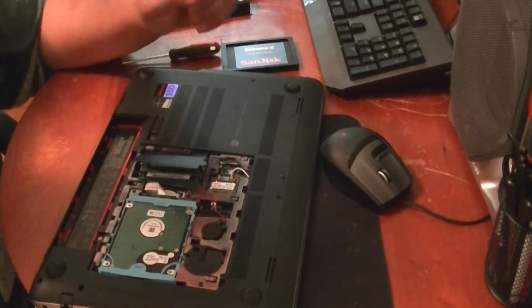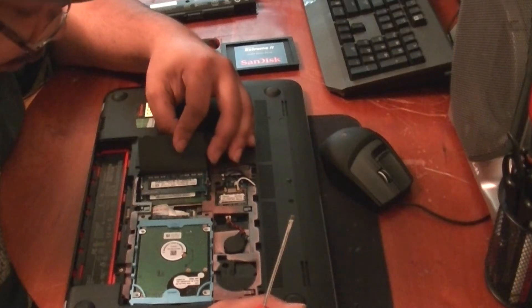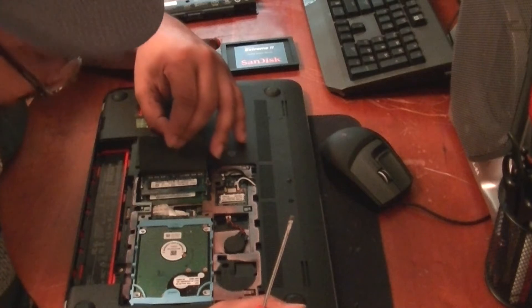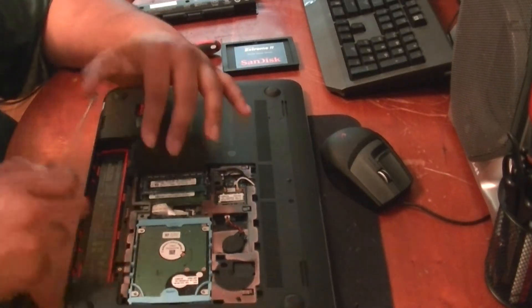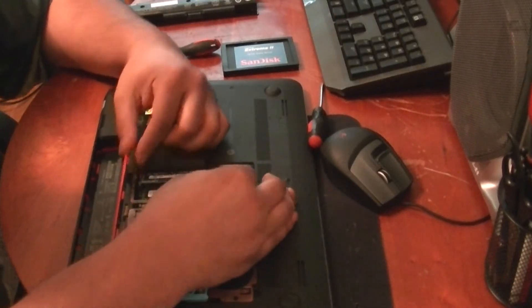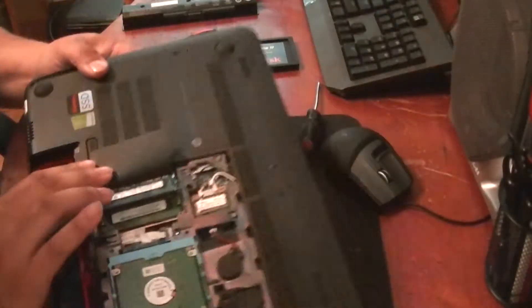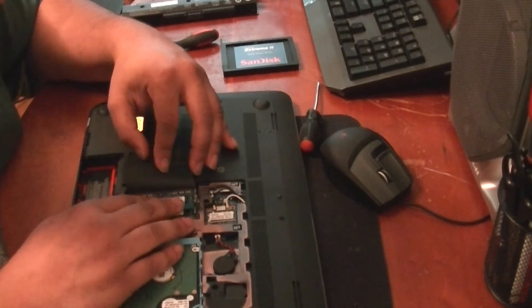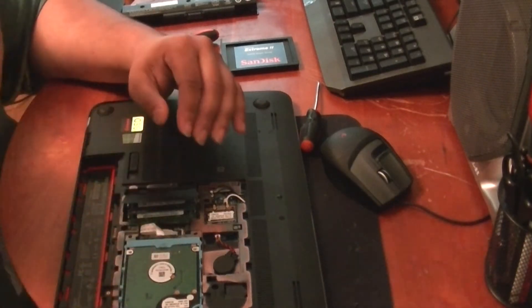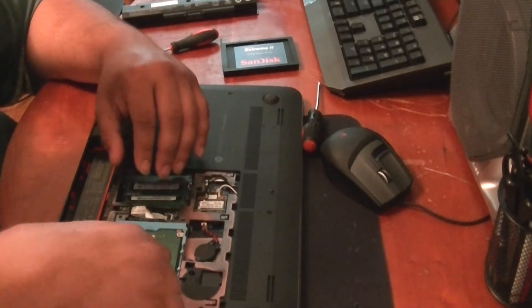Don't take these little black covers off — they're there to make your machine look nice. HP uses some kind of cheap RAM — it's SK Hynix, South Korean Hynix RAM. Even on the modules it doesn't say Samsung — just generic cheap DDR3 1600 RAM. Eventually I'm going to upgrade it. To upgrade your RAM, just lift these two little levers on the side, take your RAM out, and put your new RAM in. That'll put me up to 16 gigabytes running at 1866, which should make this machine run even more smoothly.